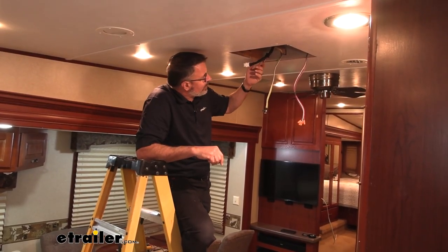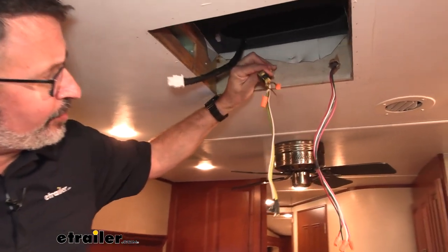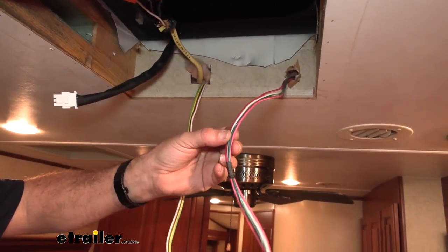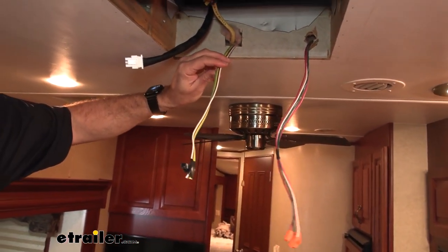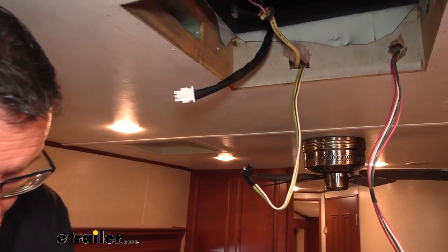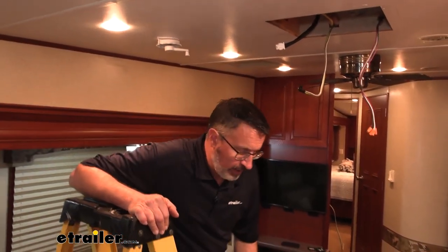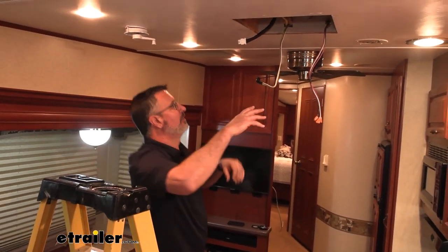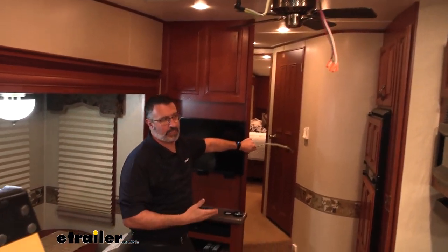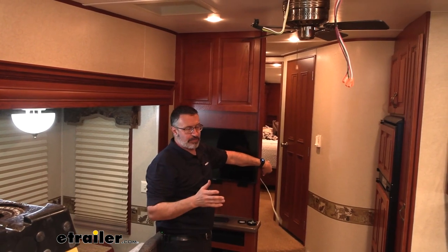At this point in the installation, let's talk about the wiring you see here. You're going to have this block coming down from the unit on the roof. You're going to have your 120 volts coming in from your camper, your 12 volts, ground, and your furnace lines. If you were replacing a unit that had a thermostat, you'll have your thermostat wires as well. In our case, we're replacing a unit that had an infrared remote control used as a thermostat, so we had to actually run thermostat lines. We used fish tape and followed from the ceiling fan, then light to light, to finally end up at this location. The manufacturer had drilled through the joists to get the electric lines through, and that's the path we followed.